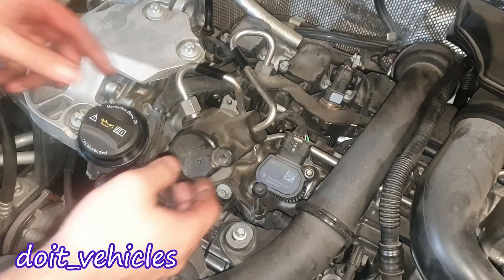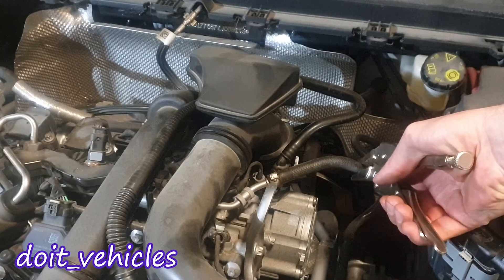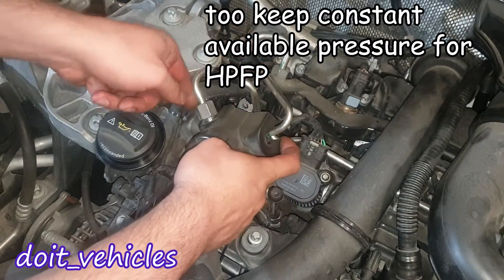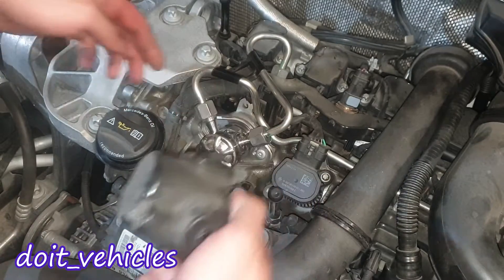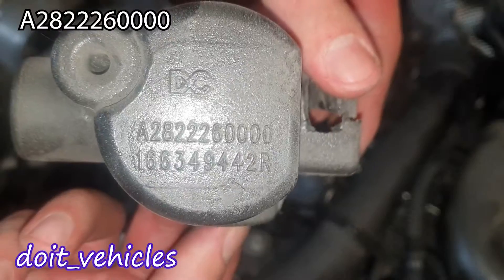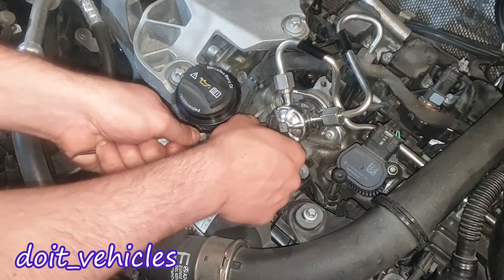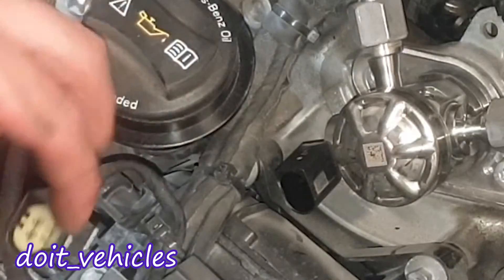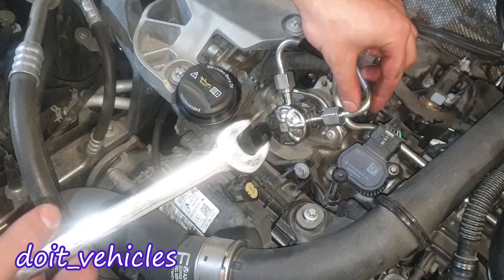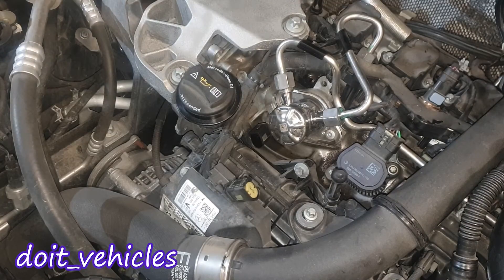Let's obstruct this line because sometimes the first fuel pump can be activated. We've got here this cushion which is meant to protect it from rust and stuff like that. Here is the part number. Let's unplug this connector — just push up this clip like that and it will come out. Next you're going to need a 19mm and remove this delivery line. There is still pressure in there.